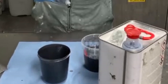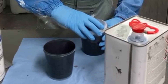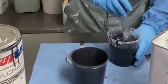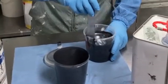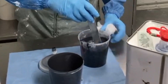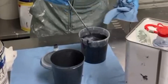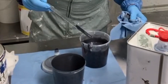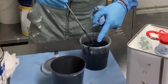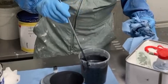The point is the first coat helps you get the opacity and helps you understand what the metallic is doing. Then you can start to make your changes. You can then make your mix and make your adjustments so you get a good few times to choose how you're going to apply this product. For those watching the video — the mixing stick is upside down because I'm mixing in a plastic bucket. There's a hole in here; it helps me mix without catching the edges and tearing the plastic and putting potential contamination into my paint.